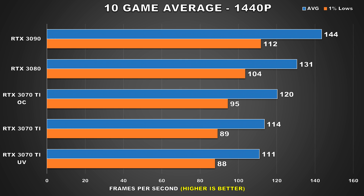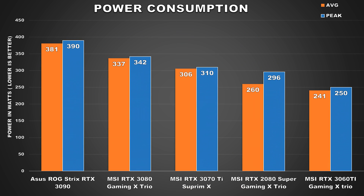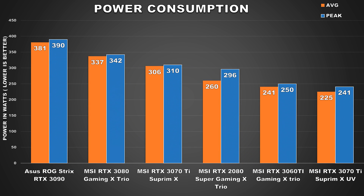Now you guys might be wondering how much power are we really saving here — is it even worth going through the hassle? Well, during our Time Spy Extreme graphics test, the RTX 3070 Ti at stock averages around 306 watts of power consumption, which was definitely on the higher side. It was pretty close to the 3080, which justified that card's power consumption given its performance level. X70 class cards consuming this much power was unheard of from a generational standpoint. But when we undervolted, we see a whopping 27% drop in power consumption, where the 3070 Ti consumed just 225 watts on average — even less power than the stock 3060 Ti. It's pretty crazy to see how much of a difference we made by just spending a few minutes in MSI Afterburner.